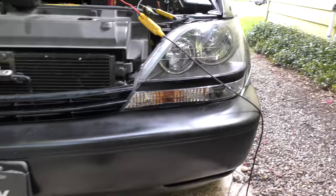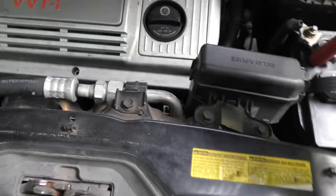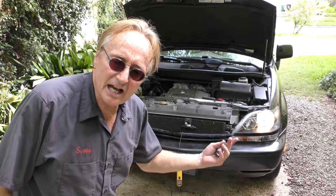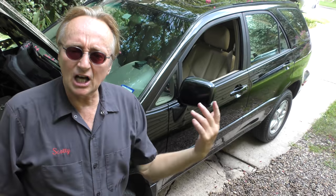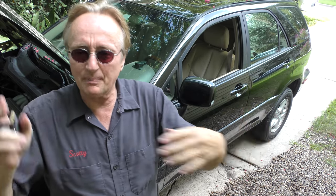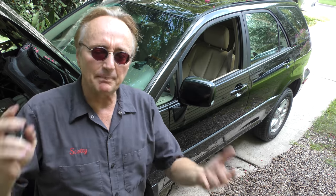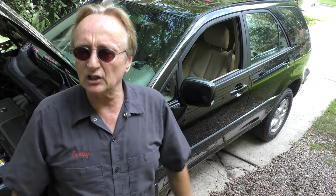When you shut the engine off, the daylight running lamps go to bed. This was the case of a bad relay - just a stupid relay in here. I'd advise changing them all; there's a lot of heat here next to the radiator and they'll just burn out over time. So there you have it - low beam, high beam, and daylight running lamps. We got lucky, it was just a stupid little relay, not the computer module. I guess it wouldn't read the computer module because when the relay was bad it wasn't powering things up and it messed it up. Any time you get bad relays or bad modules, they'll often feed back on each other and do strange things in electrical systems.